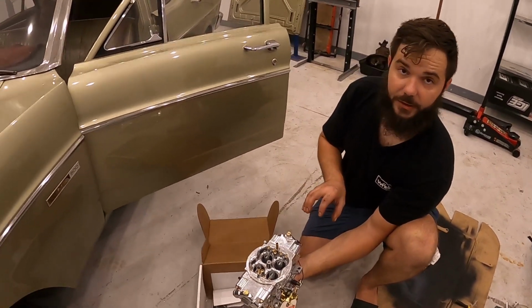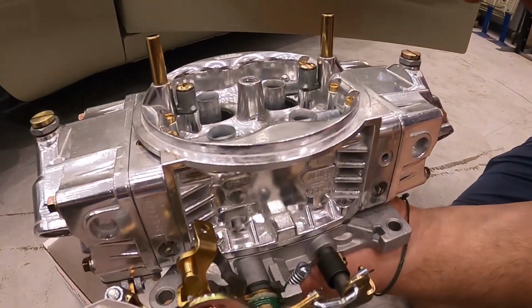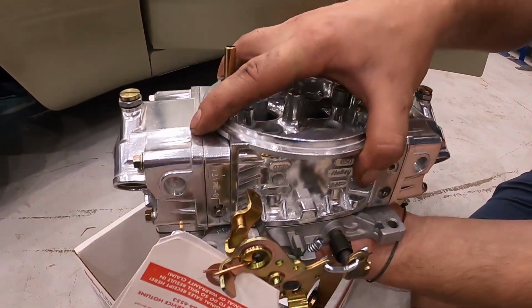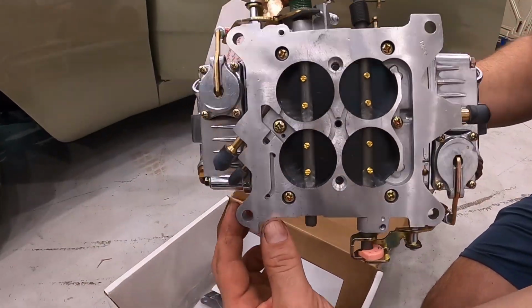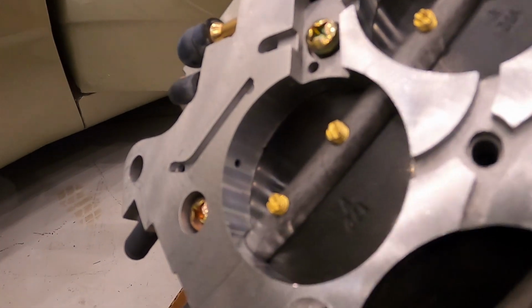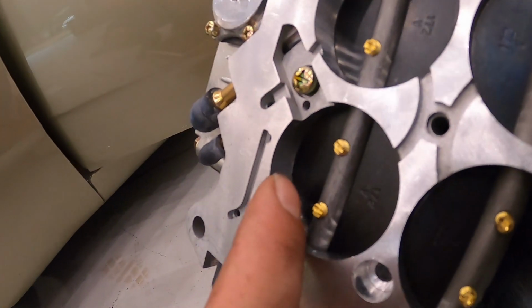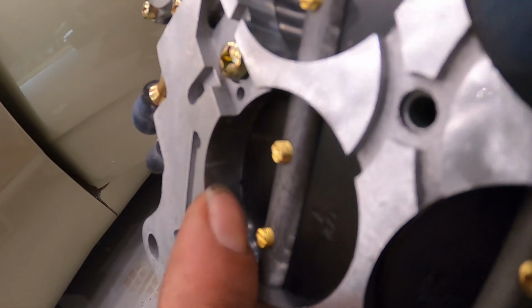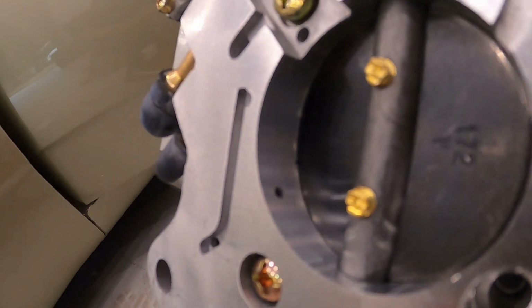There's a few little things on this we're going to run you through next, guys, before putting it on. There's a few crucial things. One of them is my old mate, the idle transfer slot. So Ozzy will run you through that. Wow, this one's perfectly set up. Guys, this is the first Carby I've undone out of a box. See that tiny little rectangle in there? You want that to be beautiful. No longer than 2 times high than it is wide.